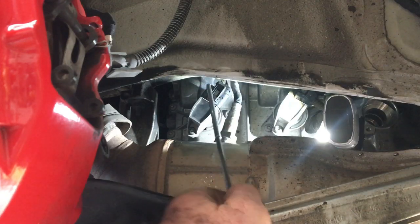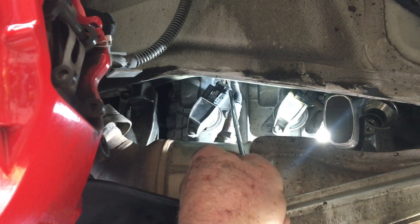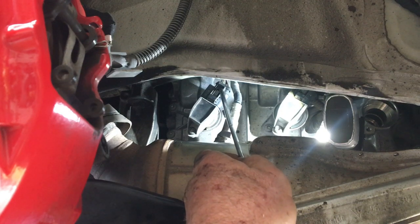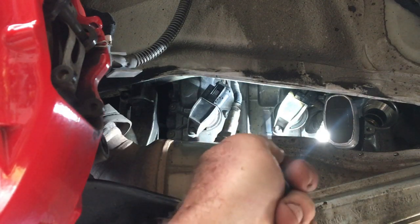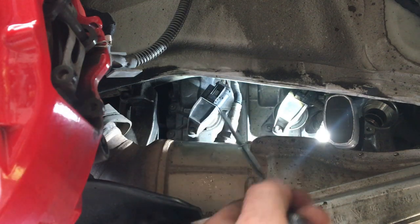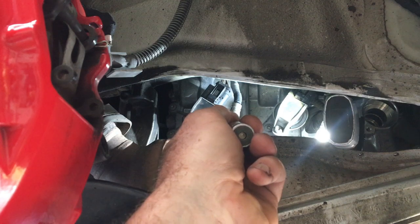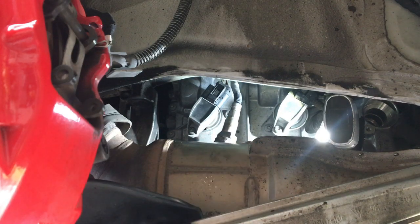To remove the plug connector, press on the top up there in towards the engine and then wiggle it up — it pops off nicely, but you'll have to get two hands in there, which is fine if the engine is cold, but if you're trying to do a compression test and keep things warm, it's a bit of a pain. For the coil screw, these are actually pretty simple on the rear cylinders, but for the forward cylinders you'll need a tool with a universal joint to get those T30 screws off. Then the coil will just pull straight out. When installing it, wiggle it back and forth to seat it correctly and line up the screw at the back that holds the coil.